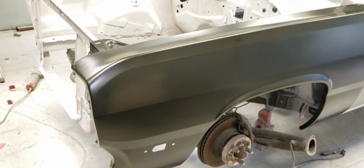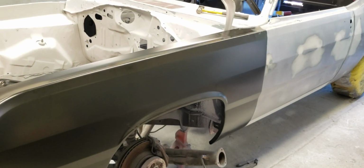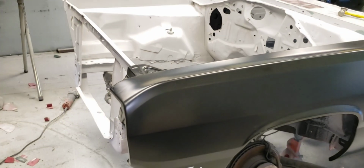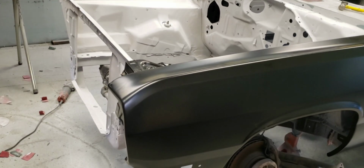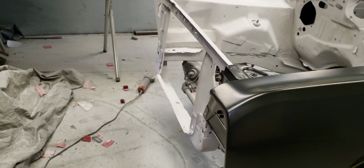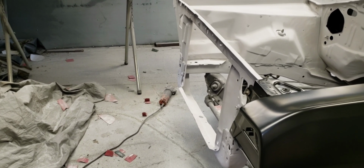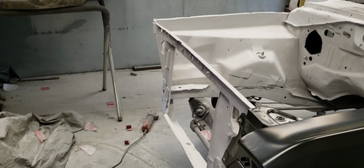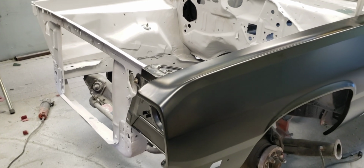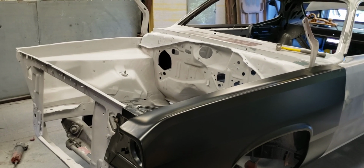But I've got to get those fenders on there and get the gaps right between the cowl panel up there and the door itself. Then I've got to stick that hood back on there and see how square that fits in the hole, because we've got three sides to line up here. The front, you can fudge a little bit. I mean, you can put shims in the hood latch and move that back and forth, and also side to side and up and down, however you need to move it to get that to fit. But I'm keeping my fingers crossed that that old hood fits in there square and I don't have a bunch of problems, because this car did not fit together well at all when we first got it.